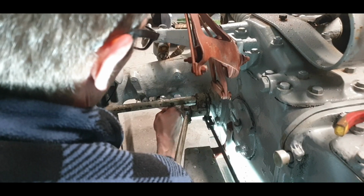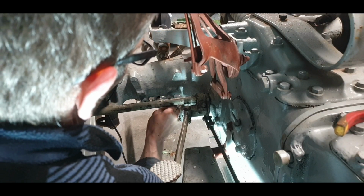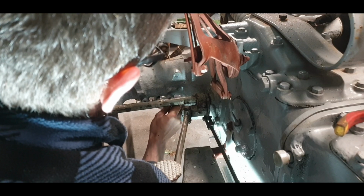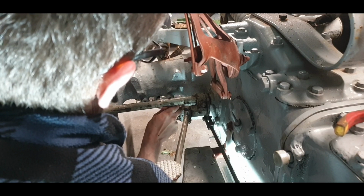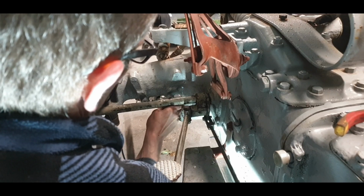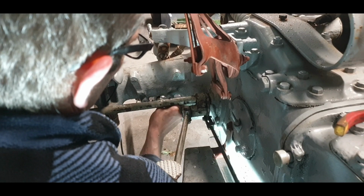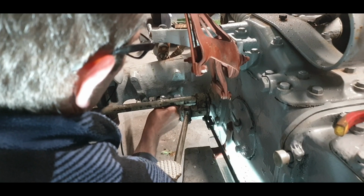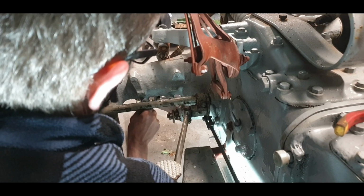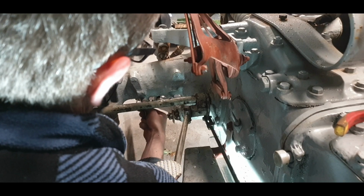Lots of stuff starts in there. This is the tap for cleaning, like, it's not the one for cutting, so you would hope it would go in. Unless I try a smaller one, but then I don't know, that's not going to work then with the bolt. It's meant to go in there. The top ones are completely plumped. Looks like the stud sheared off. I definitely should have done this with the brake rod off, but sure, look, you don't think of these things. That is fairly well clogged up now, so it is.